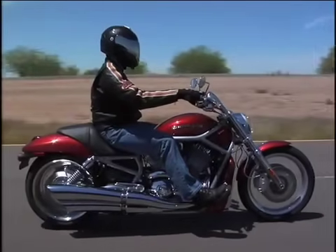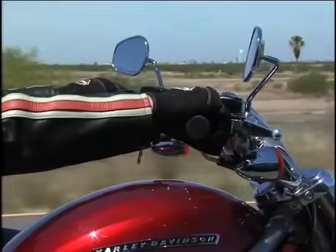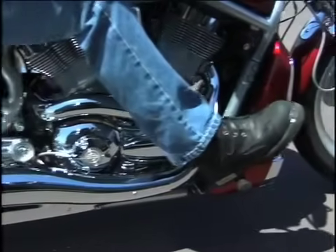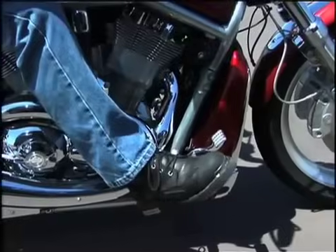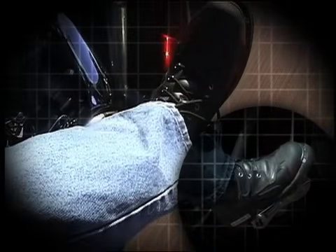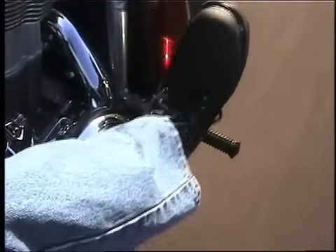And remember: Harley-Davidson's ABS is a manual assist system. It only works if you continue to apply consistent pressure to your brakes during an ABS brake event. So don't take your hand or foot off the lever or pedal when pulsing starts. And don't try to pump the brakes yourself — the system is pumping them for you, faster than you can, up to seven times per second. This pulsing sensation in the brake pedal and/or hand lever, and grinding or clicking noises coming from the module, are normal.